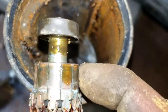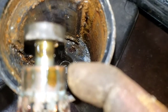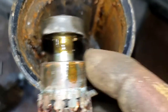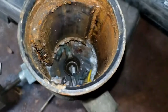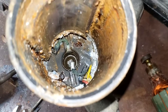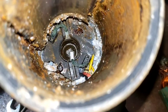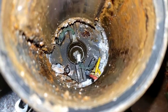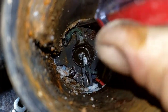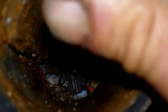That's very important because if the brushes get stuck, they'll have a gap, and therefore they will not get a connection, and no power will go to your motor — period. This is probably the number one problem with these motors, because the crud gets filled up in here and your brushes just get frozen up. They won't slide back and forth anymore.